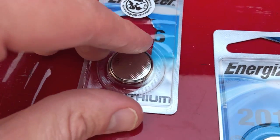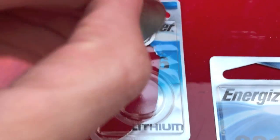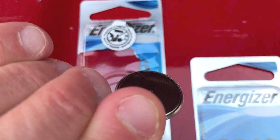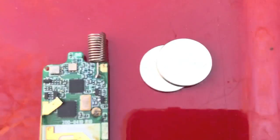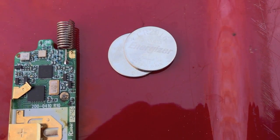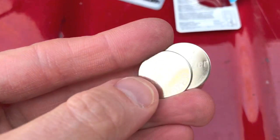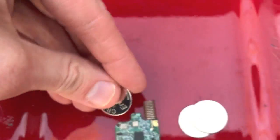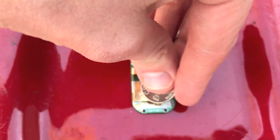After removing the battery from the package, there's a little sticker — you will slowly peel that off, and that's what the battery looks like on the opposite side. There's the positive side and the negative side is blank. Old batteries are now removed, and again that's how they were installed — with the positive sign on both batteries facing up. Positioning the positive side up and putting the two CR 2016 batteries together, I will slide them right into place.